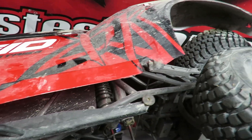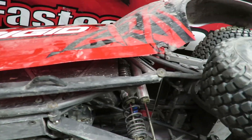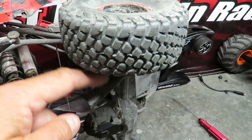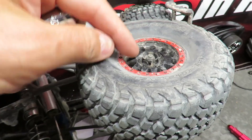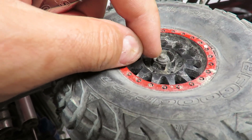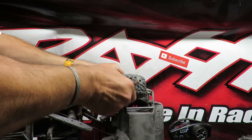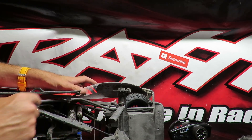The first thing to do is to release the bodywork. Sadly, my UDR has actually pulled through the plastic on both sides, so I'm going to have to come up with a fix for that in the future. That gives me access to this little screw here, which is key in removing the front end of the rear trailing shaft. I'm going to take the wheel off to get easy access. The first thing to do is remove that wheel nut — you're going to need a big hex to get that off, because the actual wheel nut, although it looks larger with the flange around the outside, the real wheel nut is tucked away down in the middle. It's the wrench that came with the car that you want to use. Once you remove that wheel nut, a bit of wiggling and jiggling and that wheel comes off, giving you plenty of access to the top joint and to the rear joint.